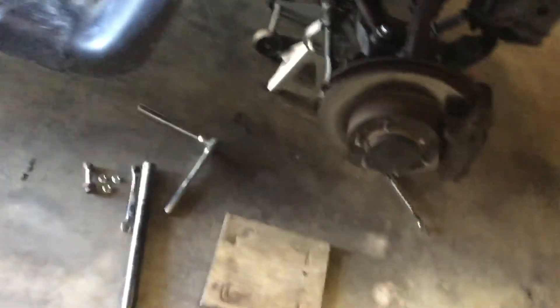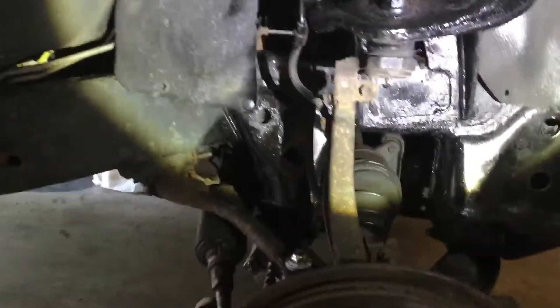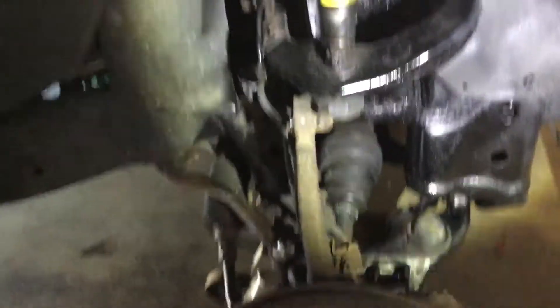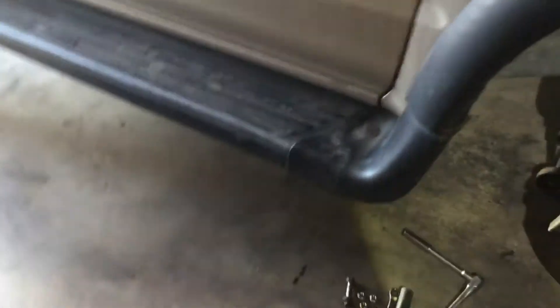What I want to let you guys know is everybody's saying break your ball joint, break your tie rod end, or take the sway bar links off. Well, here's all I did — I got this from another YouTuber, Tim the Tool Man. He puts his jack from the truck in here and pushes down on the control arm. I was able to take it off, adjust the bottom bolt, it slid right out, loosened the upper ones, and pulled it right out.